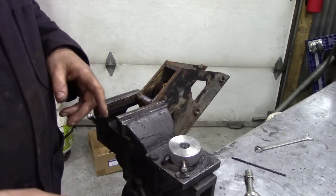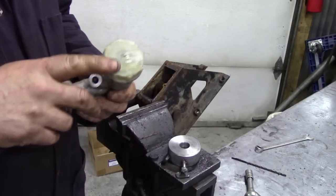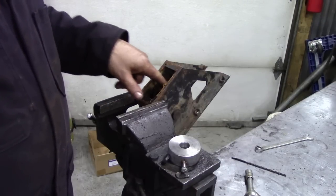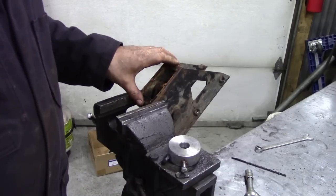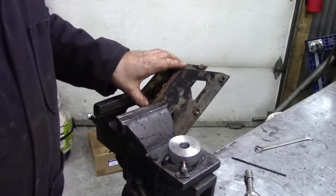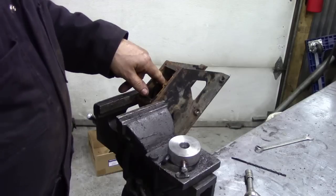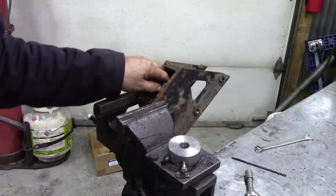The reason why they seize up a lot is that they get moisture and water in the hydraulic fluid. Also this topper was missing so water can get inside, and that's never a good thing. It's supposed to have a cover with a gasket on it — this one's missing unfortunately. Keeping the water out is very important because you can see the consequences, and an ounce of prevention is a lot better than a pound of cure.